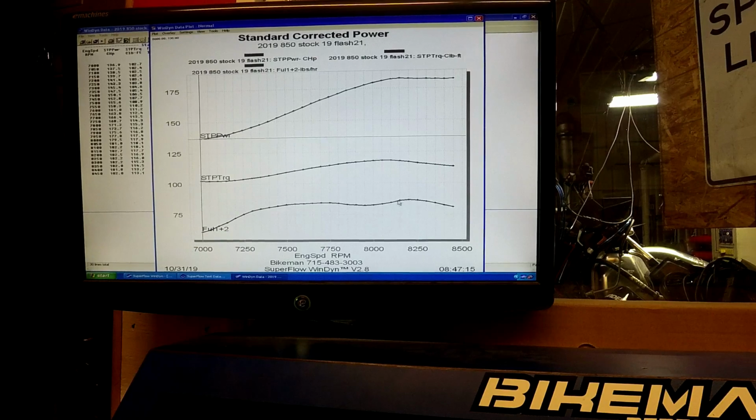because when you look at what the fuel is doing, we got a nice amount of fuel right here, but then it starts dipping off pretty good. So I'll do one more run, or we can do 6 runs just because that's what we did in the other one, and that way we got a good comparison. But that run there is 182.5 with 118.1. That's a substantial gain over what stock is.